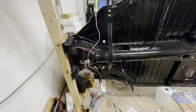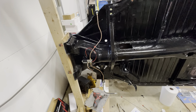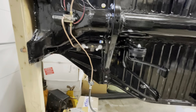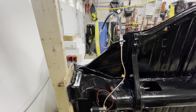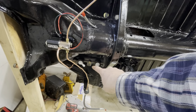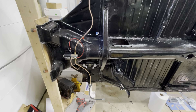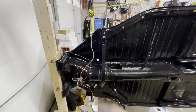Through the magic of a time-lapse, the front brake lines are in. They're a little wavy here and there so I'll work on smoothing them out — especially this one down here which has some lumpy bends. What I really wanted to make sure was that I stayed clear of the fuel line up here, so there's clear passage where the fuel line comes out, and down here I have enough space between the master cylinder supply lines, the master cylinder reservoir, and the line going to the driver's side front brake. It is plumbed up from the master cylinder, up to the line lock, and out to the driver's side and passenger's side front brake.